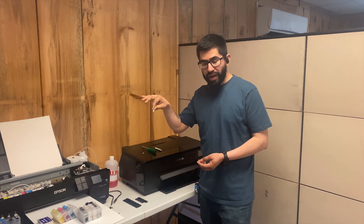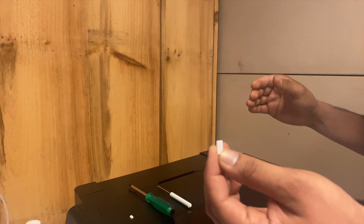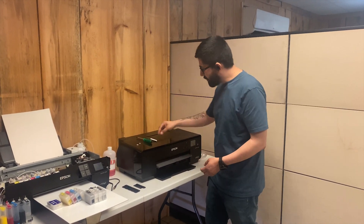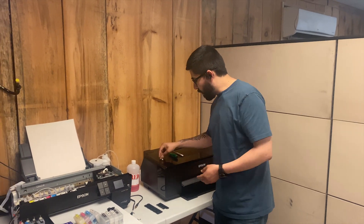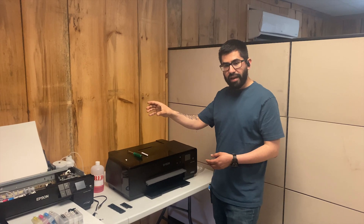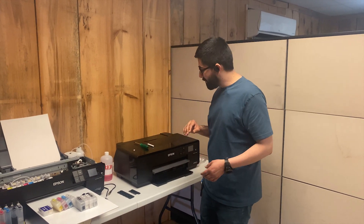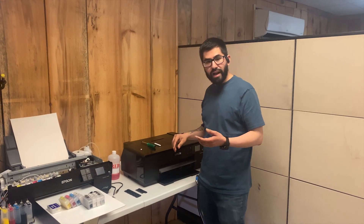Using these small foam pads — very tiny foam pads. If you're getting head strikes on your prints and it keeps smearing every time you print, I have these little foam pads that I figured out what to do with. I noticed that the print head falls a certain way and starts striking the ink when you're printing. I've come to realize that this has helped me make beautiful prints with no head striking.